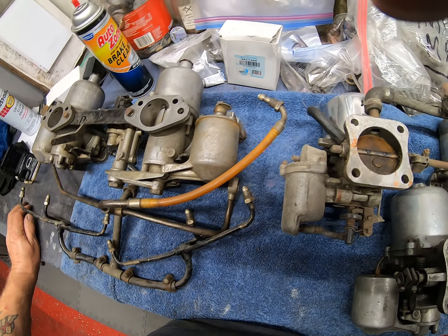This is going to be fun. I'm going to get some clear fuel line — I'm not sure where I can get that, but maybe Moss or someone like that will have it. This down here is just normal fuel line, brittle as hell as you can see. These have this style of throttle needles and jets on. I'm going to get some decent cleaner to put in my ultrasonic cleaner, but it's got to be something that doesn't harm aluminium or make it go dark. I don't know what chemical to use — I'll have to look online. If you guys have any ideas as to what to use in an ultrasonic cleaner that doesn't harm aluminium, I'd love to hear it.